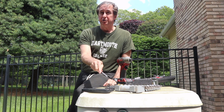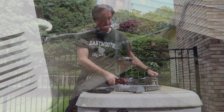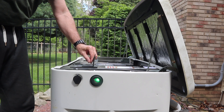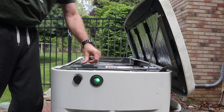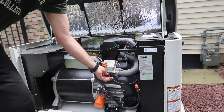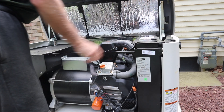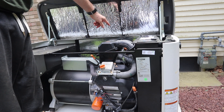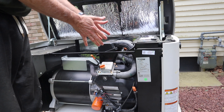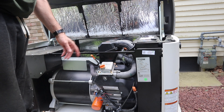I'm going to shut off my gas, remove the fuse, and disconnect the battery. Here we're going to turn off our fuel, remove the fuse, take off the panel, and disconnect the spark plug here and in the back. We're going to need to remove the spark plugs for both. I'll remove the one in the back when I get to it, but I am going to loosen it, because when the cylinder compresses with the spark plug connected, you're going to wind up developing pressure in the cylinder and you're not going to be able to rotate the shaft. So I'm going to loosen them.